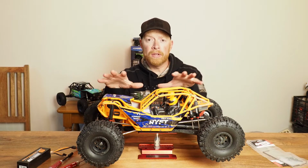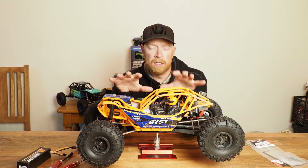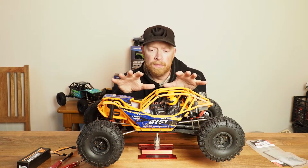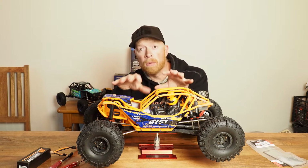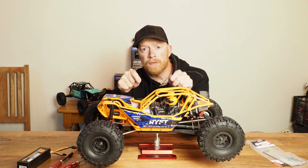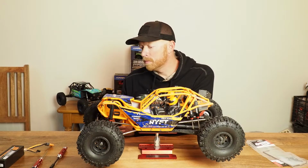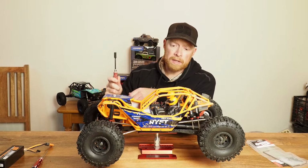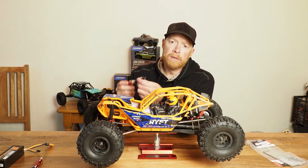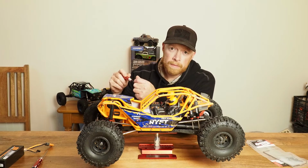Today we're going to be talking about the Ryft and in particular about binding the vehicle. I've seen a lot of people tearing the vehicle apart from the top down to actually do the bind, and that's not required. So in this video I'm going to show you an easier way to do this. The first part of the process is going to be to take these tires off. These wheels come off with an 8mm on the Axial Ryft.